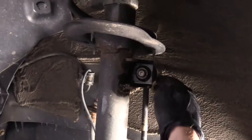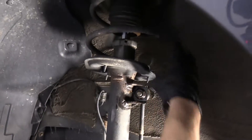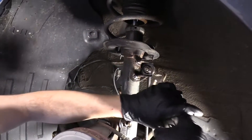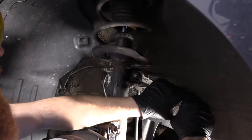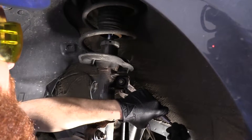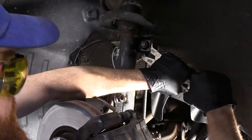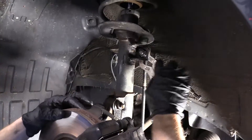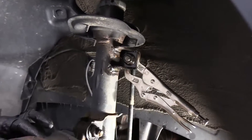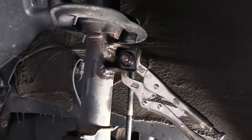So we got it up in the air. We have our sway bar link right here — this connects into the strut assembly, so we want to make sure we get this off. An easy way of doing that is using locking pliers, wherever you have access. You need to be able to grip onto the backside — there's a metal piece. You want to try to avoid the boot if possible. Get that locked on. I'm going to remove this nut — it's a 19 millimeter and I'm going to use my air gun, but if you have a ratchet with a socket you can use that.